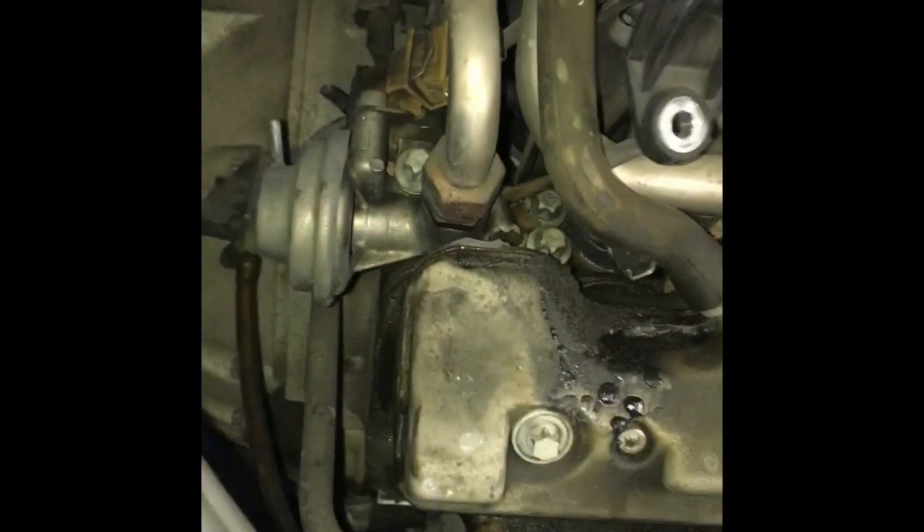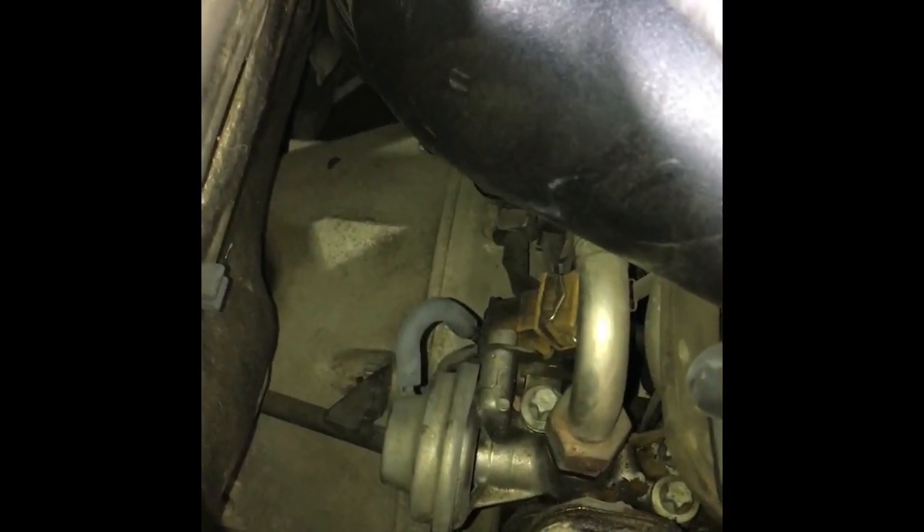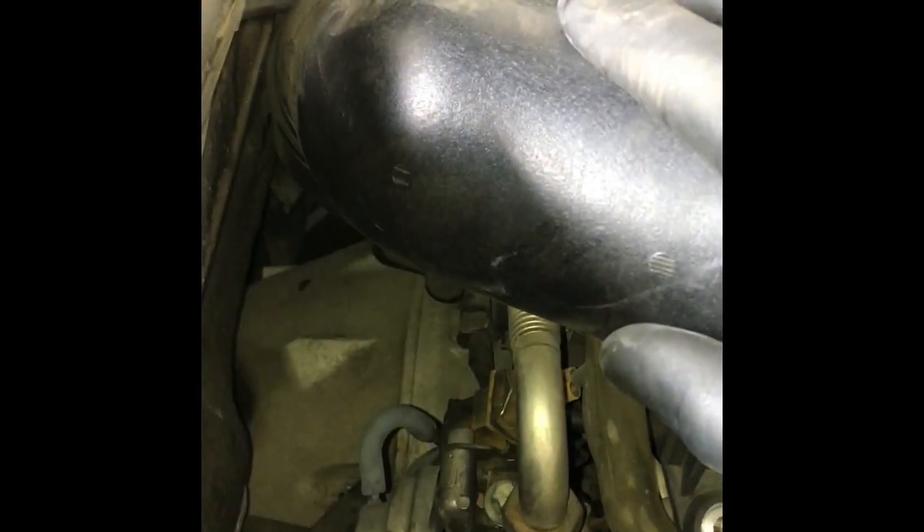As I'm inspecting, I found the vacuum switch right here, just to the right of it. If you're looking toward the back on the right side, the vacuum switch is here. And I found that the vacuum line going to the valve is broken. It goes from underneath up to the EGR valve, connecting from the vacuum switch and looping around to the EGR valve. The vacuum supply line to it was broken.